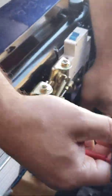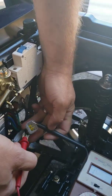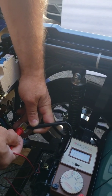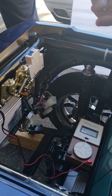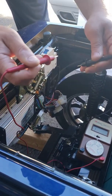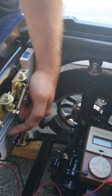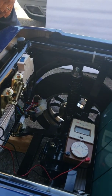With your two probes, touch those two connections — the white and the brown. As you can see, the wheel is spinning, which means the computer is fine and you have a problem with the accelerator handle — that's how you know you need to replace it. But if you touch those two wires and the wheel is not spinning, then you have a problem with the controller. In some extremely rare cases it would be the motor, but that will be covered in the next video.